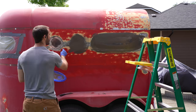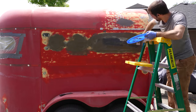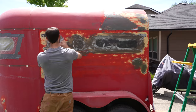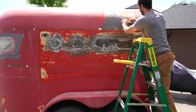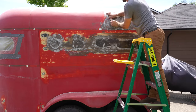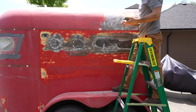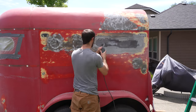Because I'm applying over some large welded surfaces and I have some reasonably deep dents still, I'm putting down a layer of fiberglass reinforced resin, sometimes referred to as kitty hair. Since this stuff is so brutal to sand, I'll start by knocking down any major high spots with the body file once the resin is set up but not fully hardened. Then I'll follow up with an orbital sander and some 80 grit sandpaper.